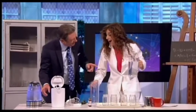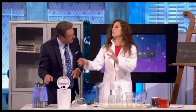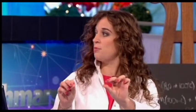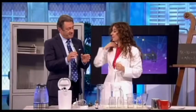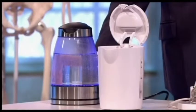At the top of the kettle, in the heating element itself, there's what's called a bimetallic strip — a strip of two metals. When the water reaches its boiling point at 100 degrees, one of the metals expands faster than the other, so the strip bends and breaks the points of contact in the circuit, shutting off the electricity. All metals expand when heated, but at different rates, causing it to twist and break the circuit.